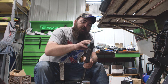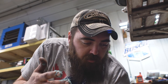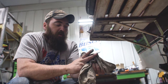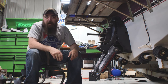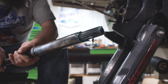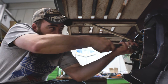You're going to lube the alignment tool so you can see the spline marks — get plenty on there. You do this so that when you insert it, if you get into the splines, you'll be able to see the spline marks going all the way down through the grease. Sometimes it'll feel like you're all the way in there and you're not. This one was perfect — see the spline marks? That's how I knew it went all the way in. Just that smooth. If it's not that smooth, the engine may have moved on the motor mounts, or you haven't got the gimbal bearing twisted into the right direction for everything to go together correctly.